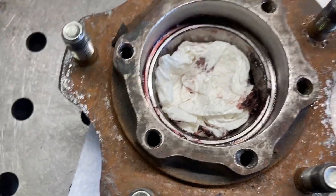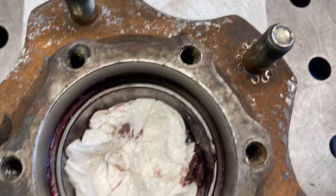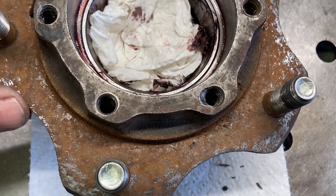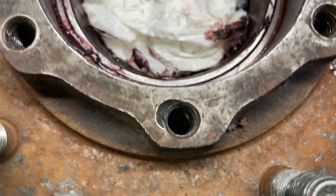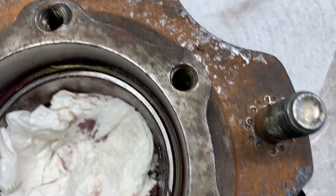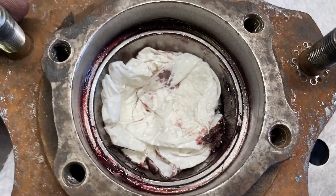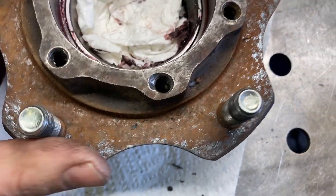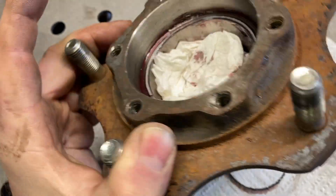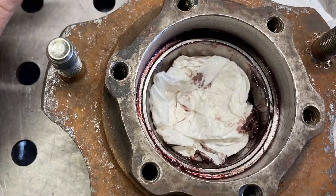It's really important to use a drill press - you want these holes to be absolutely straight down with the hub. These ones might give me some grief; hopefully it doesn't walk off to the side. I have a couple spares. I'm on a time crunch - the local auto parts store doesn't have any seals in stock, so I'm going to pack this with paper towels and mask it all off to keep the drill shavings out.